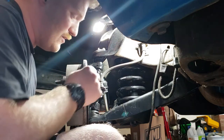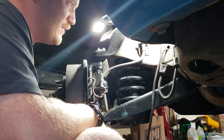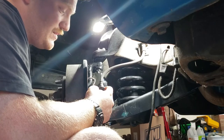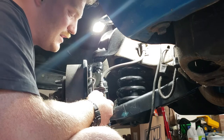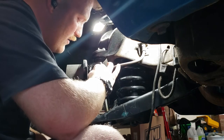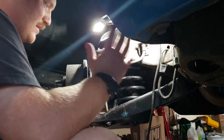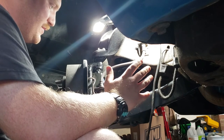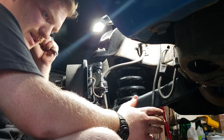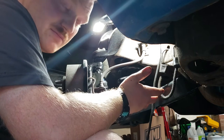I think I did it. I had to create my own washer for this bracket to hold it on securely. This pressure clip was pretty bent out of whack — wasn't holding anything. Previously this was just kind of floating around in here. Now I have created a new hard line using the old spring, cleaned up the brake. I think this might work — I don't know yet. I've got to bleed the brakes and see if the fluid starts leaking. If it starts leaking, I guess I've just got to make another one. We're close.